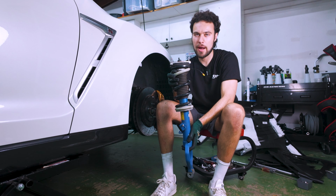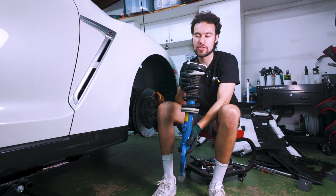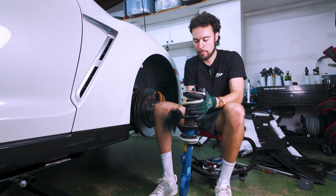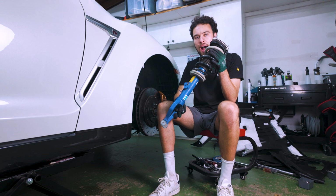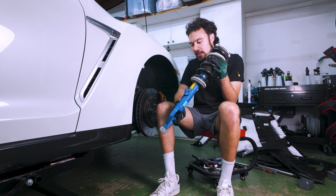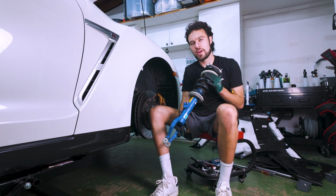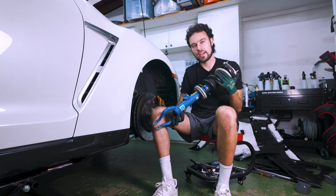You can do that by pushing the upper control arm out of the way, and you can pull this out. Once this is out, there is not enough vertical space for you to continue pulling it all the way. So to create that vertical space, push this end as far forward as you can. You want to tilt it. To do that, you can push the lower control arm down a little bit, being as careful as you can not to damage anything. With that, you can push this forward, and once that's done, you can rotate everything out and around and out. That's what we ended up doing.